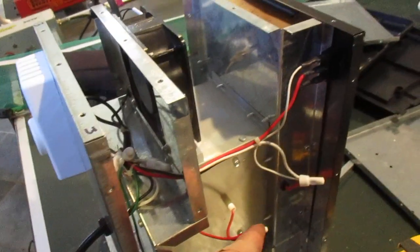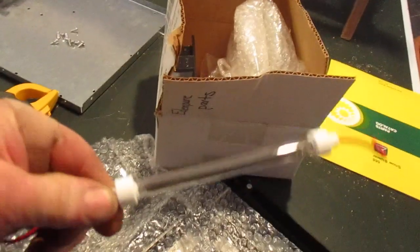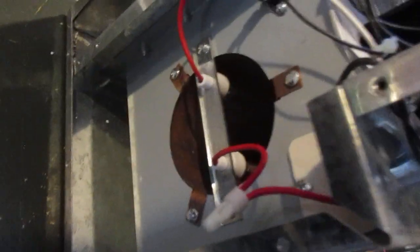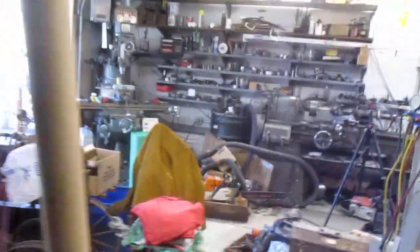I got it all apart and I've got to test it. It has little light bulbs in it - that's what makes the heat. According to the wiring diagram they're hooked from one to the other in series, so if one of them is burned out then none of them will work. I know how to test it, I just got to do it. But that's nighttime stuff - today's daylight stuff.